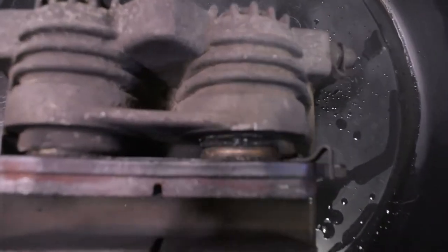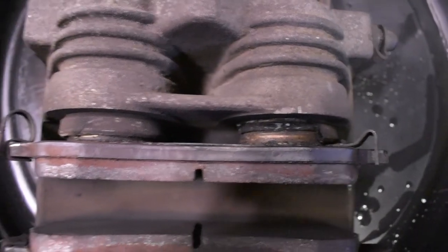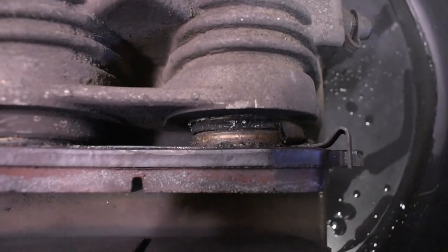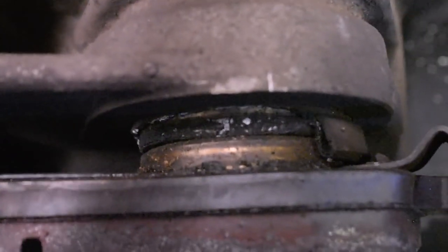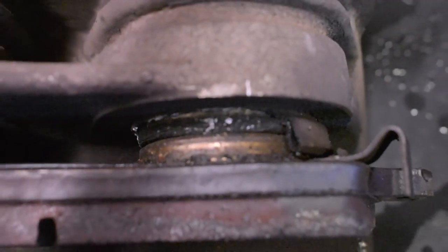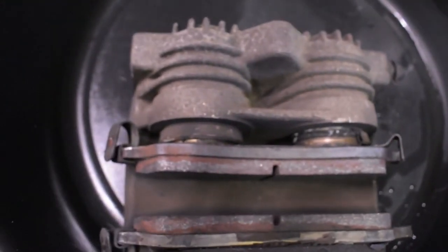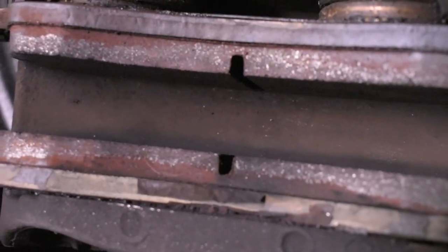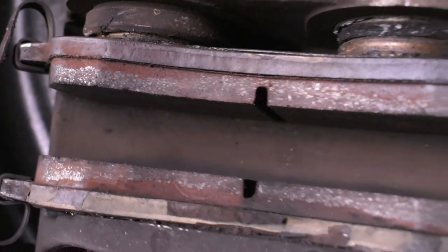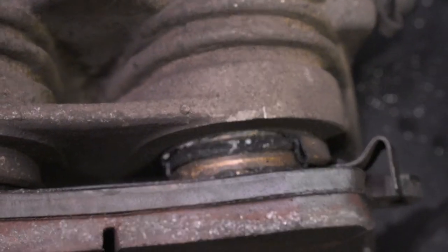One of the reasons you might want to consider a brake upgrade or a brake refresh: at the track I cooked that brake caliper boot. It's still sealed — not pushing fluid out — but obviously if I wasn't upgrading I would fix that with a rebuild kit. These are pretty much new-ish Hawk 5.0 performance street pads. As far as I know they're okay, but the caliper would need to be addressed.